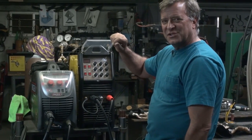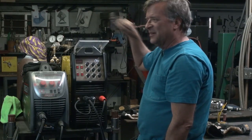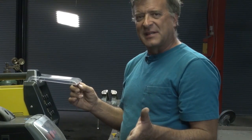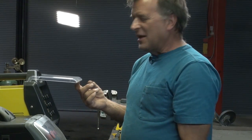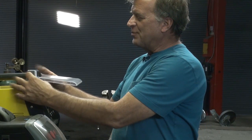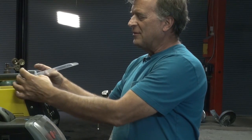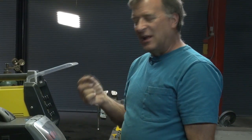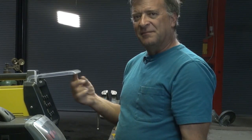The on/off switch is still located on the back left-hand side of the machine, so you've got to reach back there to get that. And it's got this little plastic cover that goes over the control panel to help keep it clean. I know on the first model I had, that thing only lasted about a day before one of the little hinges broke — just snapped right off. I learned a trick: when you open it, put your fingers right up here on the hinge and pull forward just a little, and it slips right up and holds in place. When you go to close it, put your finger under it and pull towards you just a little, and it will slide right around the little catch on the back side. If you just try to force it up, that's why they break. Pull it forward a little bit and it pops into place, pull it forward again and it drops right down — no click, no snap. You're not putting any strain on that little plastic hinge.